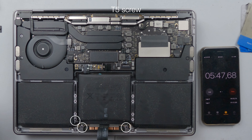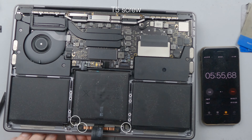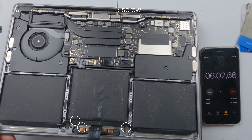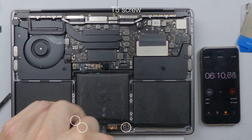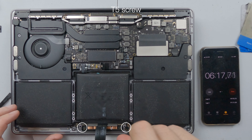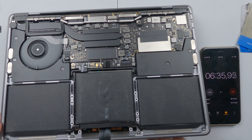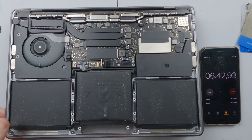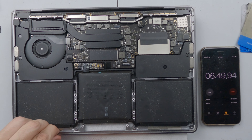Before doing the last screws, in order to protect the screen I'm going to lift this up ever so slightly and place a rag underneath, just in case when it comes down nothing gets scratched. Now if I open this up you can see very nicely that the trackpad comes out very easily, and because I've done it like that none of the washers on there have to be moved.